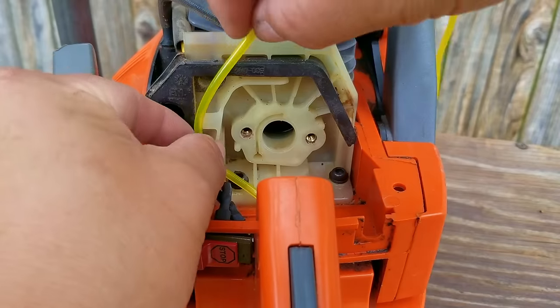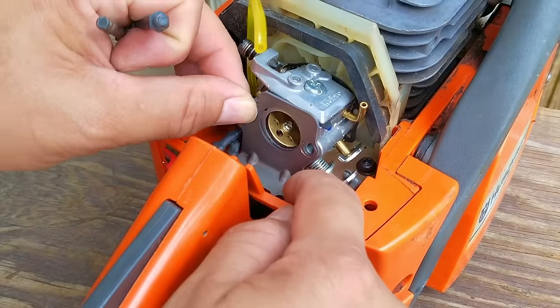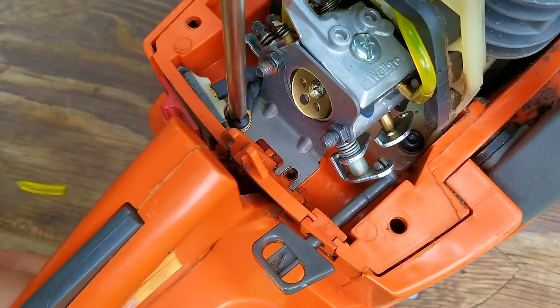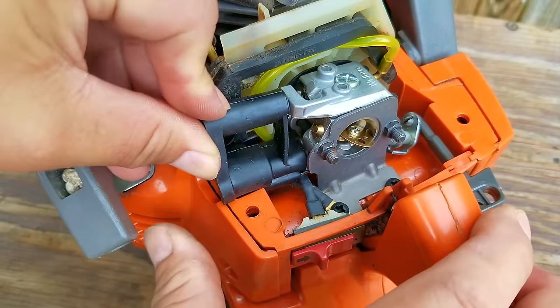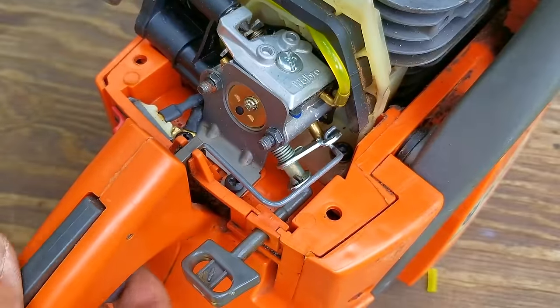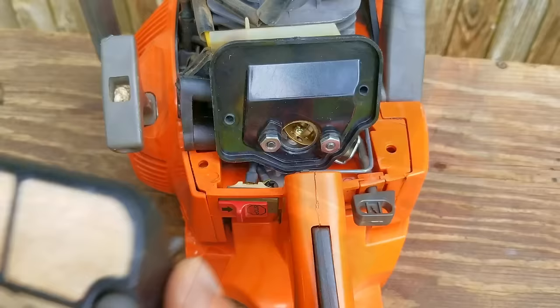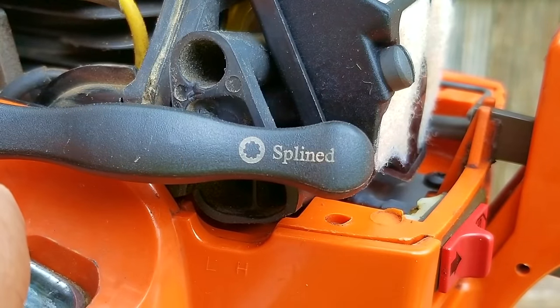After putting the filter back into the tank, make sure there's enough fuel line for the filter to rest against the back of the tank — this helps ensure the engine has plenty of fuel when turning the chainsaw on its side. I'll cut the line so it's near the port on the carb, then install the carb back onto the engine. Once the saw is back together, remember that without a purge bulb and the carb being empty, the first couple of pulls will only serve to pull fuel from the tank to the carb. The pulls after that will then try to start the engine. We might also have to adjust the carb to get it to run correctly, and for this one you'll need the splined carb tool — there's a link in the description. The L screw is closer to the engine and adjusts fuel at idle speeds; the H screw is closer to the air filter and adjusts fuel while the trigger is squeezed at full speed. You might also have to adjust the idle speed, which is at the opening at the top.